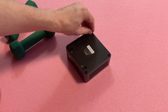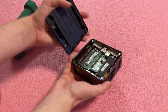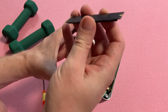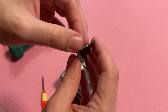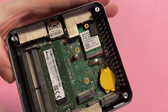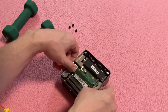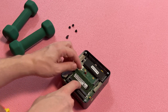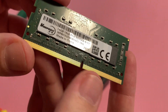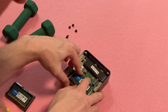Let's have a quick look inside. To open this mini PC, all we need to do is take out four screws, turn it over, and the bottom comes straight off. At the top we have the 1TB NVMe by Lexar — the same 610 Pro that we saw in the K2. There's a very thin copper graphene heatsink attached, which may be working as the drive sits around 60 degrees Celsius. Underneath that sits the Realtek Combo module, which controls WiFi and Bluetooth. More interestingly is the single stick of DDR4, and this mini PC can support dual channel. So we're going to insert two sticks of Crucial memory and see if we can get any more performance.